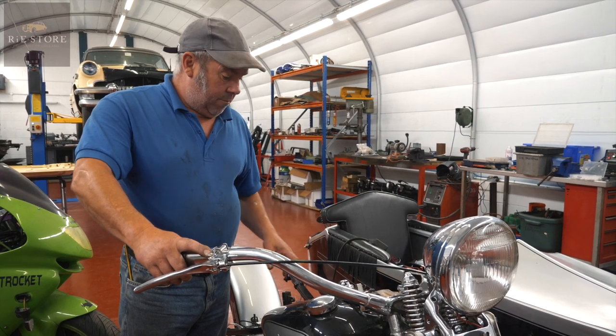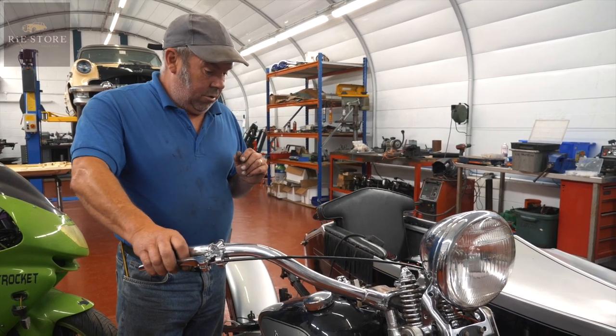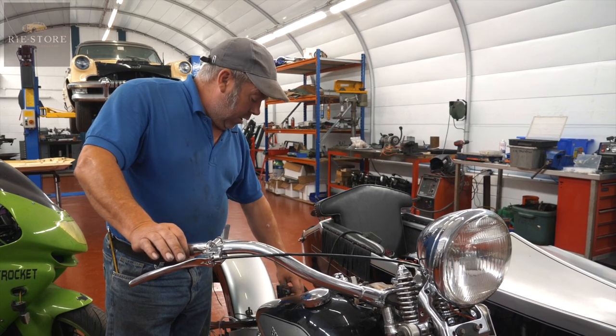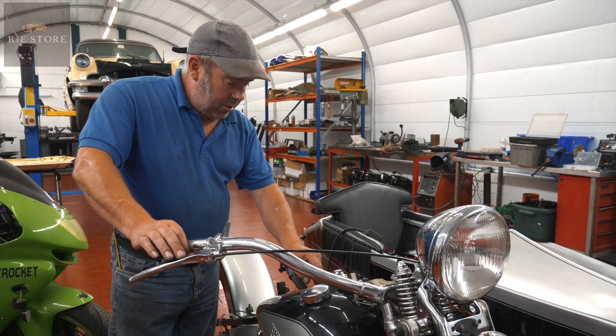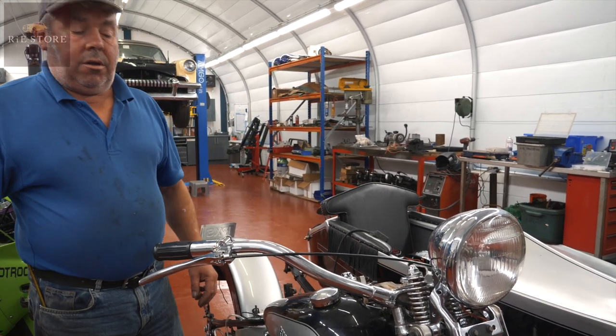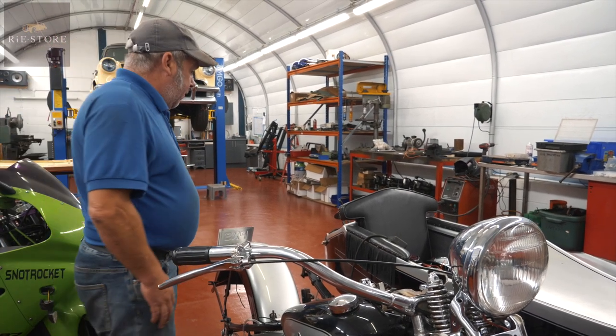So, now it's just a matter of going through. Is there an order you do it in at all? Well, you check to your terminal post there, then you know that your live from there goes to there, so you check that. And how do you check it? Do a test lamp. Okay. Chances are I've wired it up wrong. Yeah. So you just got to eliminate it bit for bit, you know.